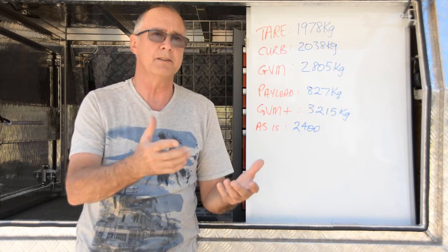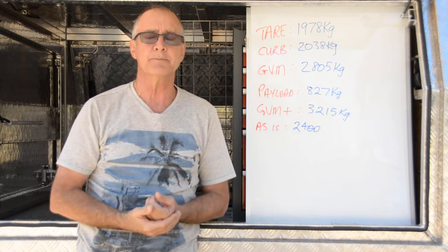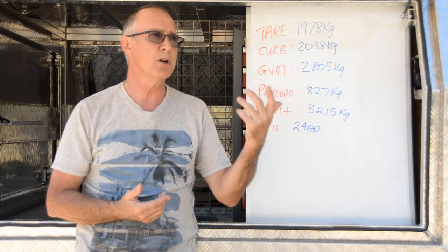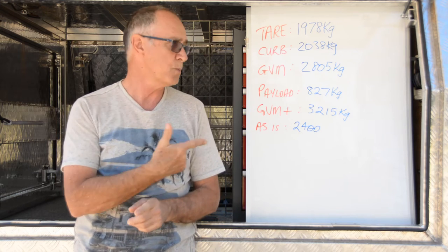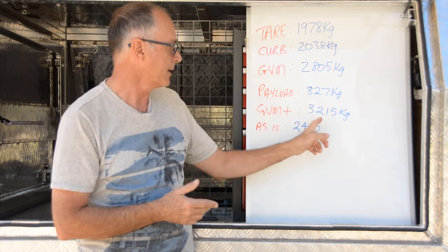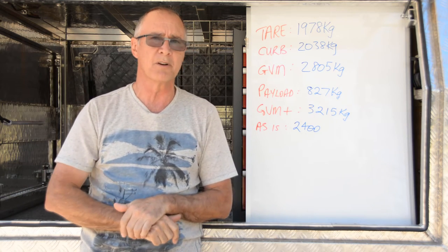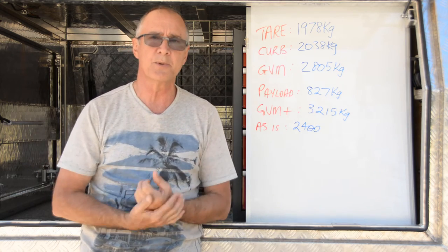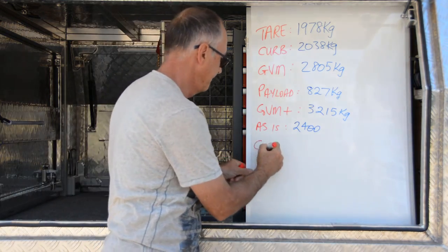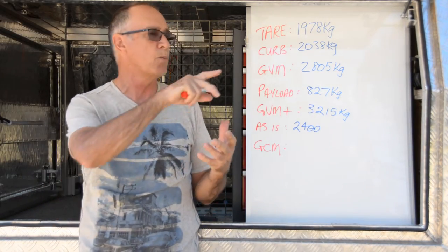You still need to manage your weights carefully — recovery gear, tent gear, a shovel, spare tyres on the roof all add up quickly. If something happens on the road, the police and insurance company will want to weigh the vehicle, and if you're over your GVM limit, the insurance company can refuse to cover you. There's also another consideration: the GCM, or gross combination mass.